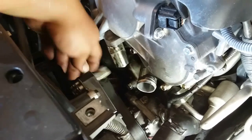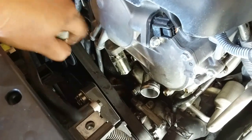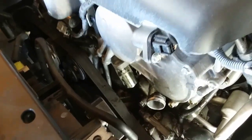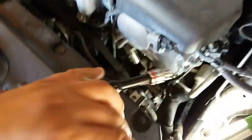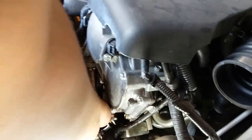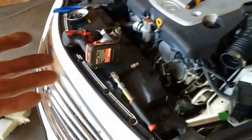There's a pigtail that you want to unplug from this sensor here — just press on that pigtail down and out it comes. There was oil leaking so I put it back in and just removed the pigtail. The tools you're going to need is just a 10 millimeter socket — you might need an extension. There are three screws down here: one, two, right there. After you remove those, just wiggle the thermostat housing back and forth and out comes the thermostat.